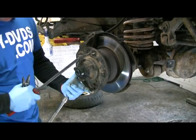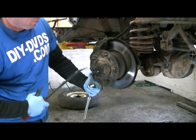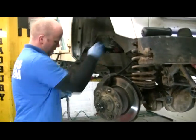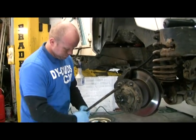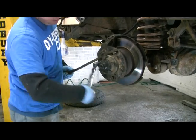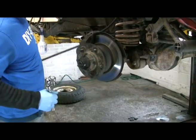So now, before you take the wheel off, if you've got standard steel wheels where you can get to these bolts in the middle round that cap, loosen them all off before you lift the car up. Otherwise it's not really a problem unless they're super tight. Right, next job is loosen all the bolts. I have loosened just a couple of these already. So we've whipped all the bolts out.